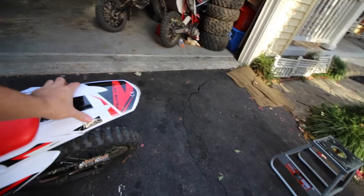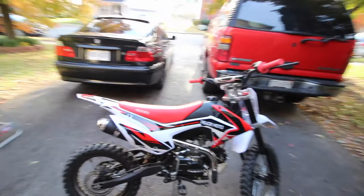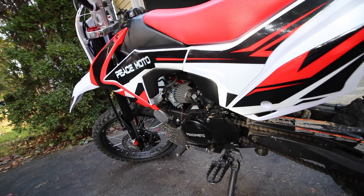I kind of went down pretty hard just now. You guys probably saw from the video — I don't know if it got in the shot, I think I was too far past the camera, but you definitely heard it on the mic. I basically kind of overshot it, went too far back, because the choke was open the whole time. When the choke's open you're going to feel more power, and I wasn't ready for that. It kicked back pretty far. I didn't hit the rear brake, which was my fault — something I was practicing. Sometimes when it gets too far back I get scared and bail out.